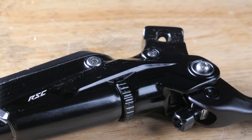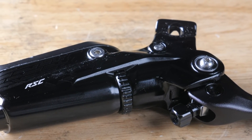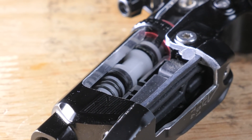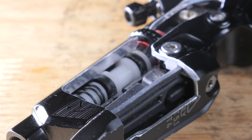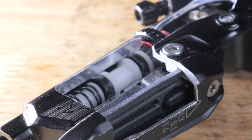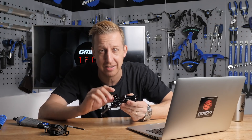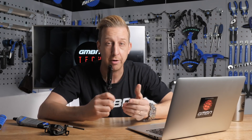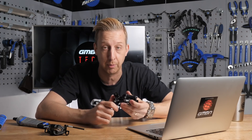The same applies at the brake lever end - if any of the bolts are the slightest bit loose, fluid can leak out. Where the hose goes into the lever itself, you've got an olive attachment and a barbed setup going into the end of the hose. If these are loose, old, or the nut is not tightened sufficiently, the same thing applies - even the tiniest amount of air can be enough to make your whole system go on the blink. But nine times out of ten, a good thorough bleed of your system will cure these problems.